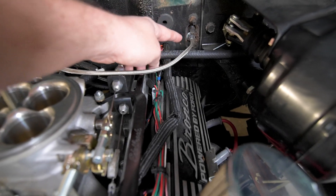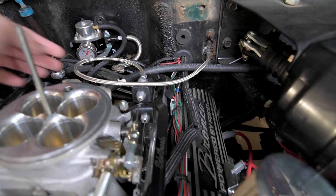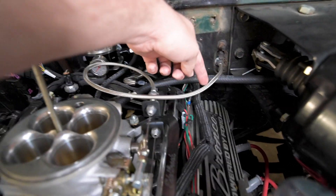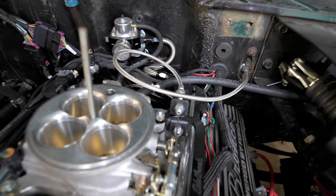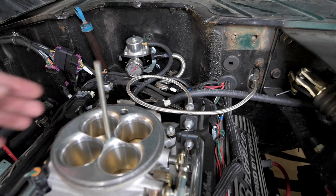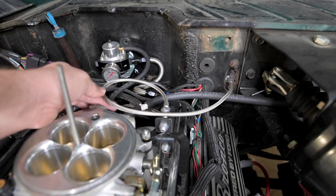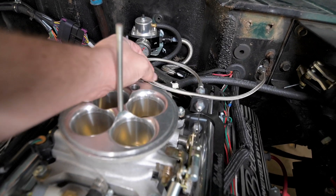What you don't want to do is get a cable that bends and makes an S right here, because the cable inside the braided sleeve doesn't bend and doesn't take sharp corners. You can see mine kind of wraps around this way, and that's been great — it works really well. It doesn't look awesome, but it works. Same with the kickdown cable: there's a certain length you need, and I have links for those too. It's a steel braided sleeve and it works really well.